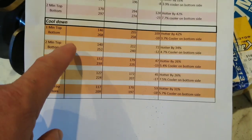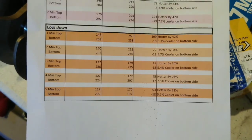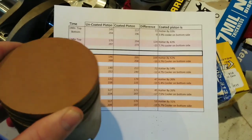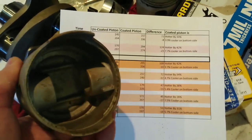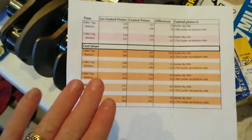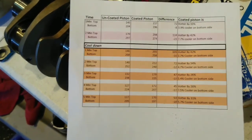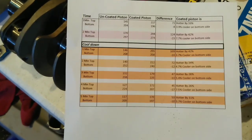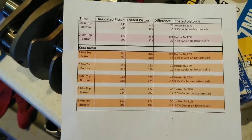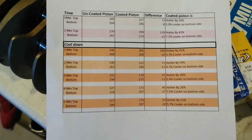In the same respect, it was hotter on the coated piston on the surface. It appears that the thermal barrier retains the heat on the combustion side and keeps it from going through — which makes sense, it's an insulator. I'll take a picture of the data and post it at the end of the video so you can study it and make your own decision. Is it worth it? Depends on what you're trying to do. I'm going to take a stab at it and see if it will keep the engine cool. Alright boys and girls, see you later — don't forget to like and subscribe.